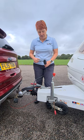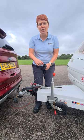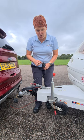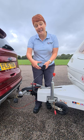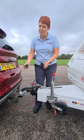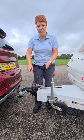What can happen with a 13-pin plug — that might be hard for you to see here — is that there's a little tooth of plastic in there, and it should always be at 90 degrees to the disc. It can easily come out of alignment if you've maybe been a little bit forceful trying to get the plug into the socket on the car.